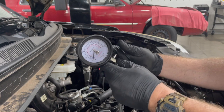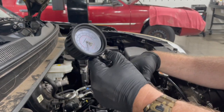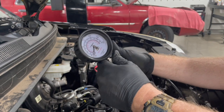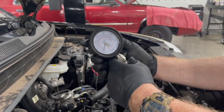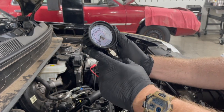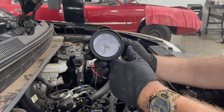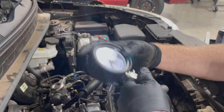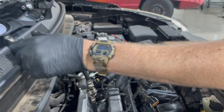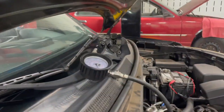One important thing: it is best to hold the accelerator pedal all the way open. That allows plenty of air into the engine so it gives you an accurate compression reading. On this particular car I'm going to get in and hold the throttle pedal all the way to the floor while I crank it, and Jake is going to film the gauge. On an older car you might need a helper for that.